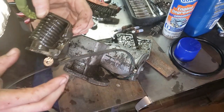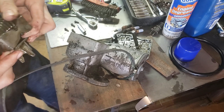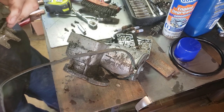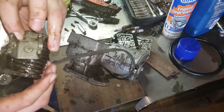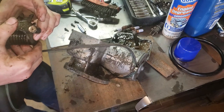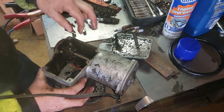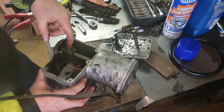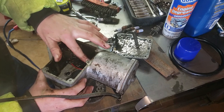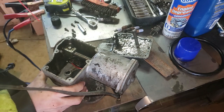And then this stuff here, this is pretty simple. So I just wanna make sure this is all good yet. That spring's not broken. I wanted to check that. This pin's on here, that's tight. This is here, that's tight. So that I shouldn't have to worry about. And that's really all the system is. And then those two claws, they clip onto here, and then all they do is go up and down with this worm drive. And then that just spins that whole deal in there, moves that shift fork. So, looking a little better.